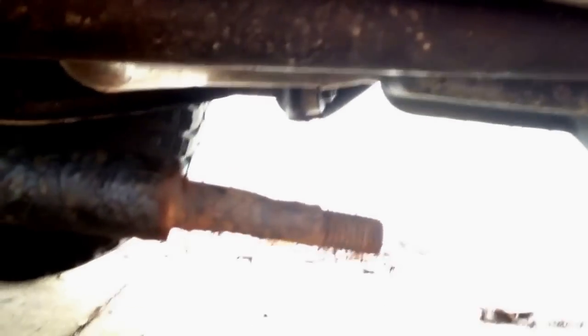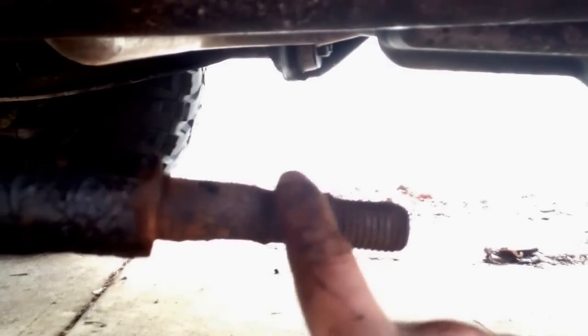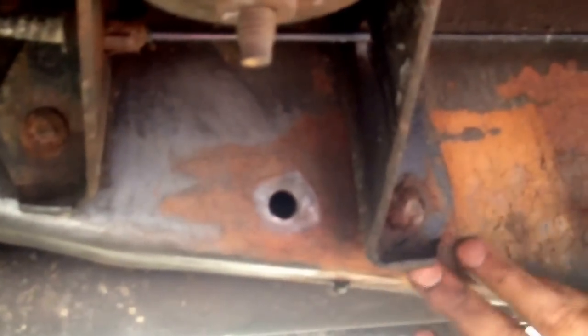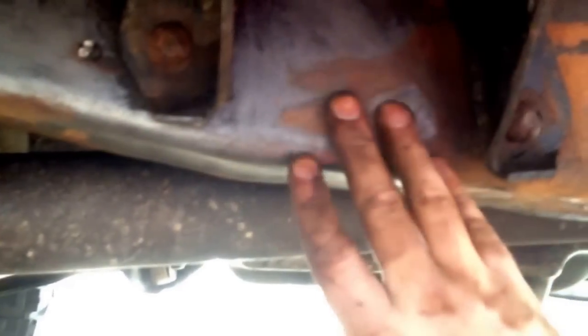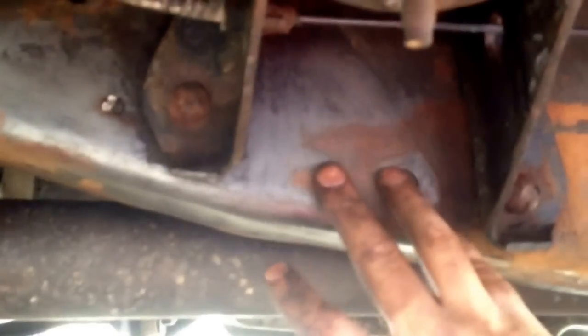Everything's been taken off and is ready to go on. This is the end of the radius arm — it's got some grooves from normal wear. I'm going to eventually replace this radius arm, either with a lift kit or just a new one. Here's the frame where everything came out — I cleaned and brushed it off, and it's in decent shape with just some surface rust. Next I'm going to put on the bushings at this end, put the bracket on, pull it up, bolt it back loosely so I have some play, then put the other end of the bushings on and tighten everything down together.